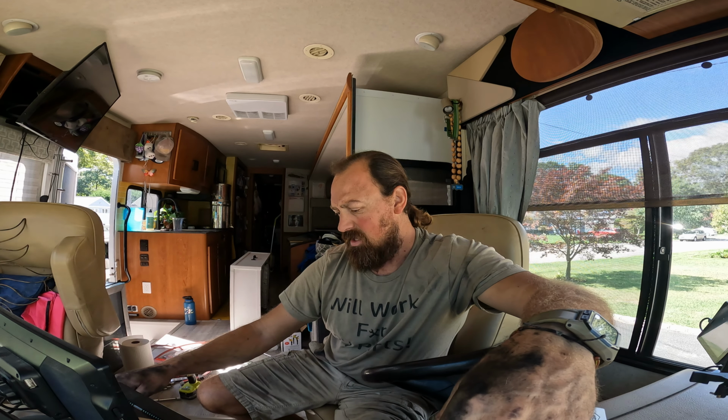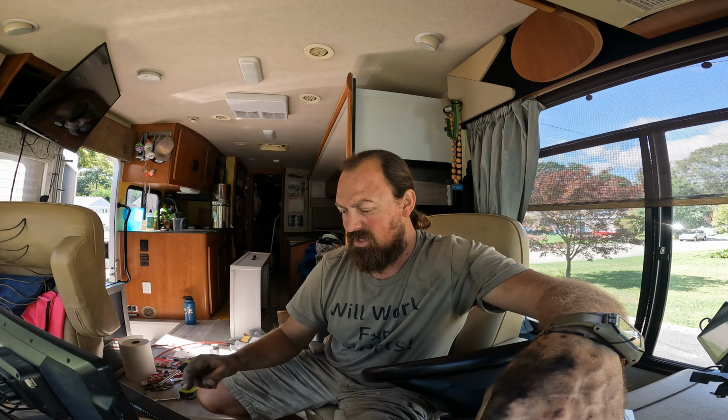So let me say that the method that I talked about in the beginning, the hot method where you let the engine run for 20 minutes and then do the extraction, worked using the impact hammer, the Ryobi that I have. That worked, and having this small one let me get it into the tight spots of the engine, except for the front one on the passenger side. So that one I was able to wiggle it in there and get it, but for the most part I had to use hand tools up there.